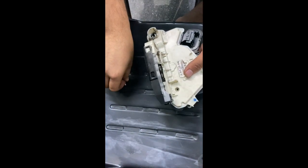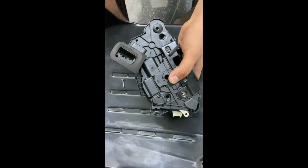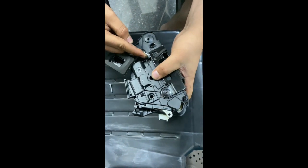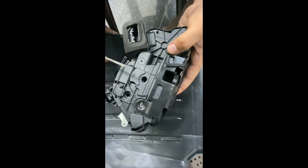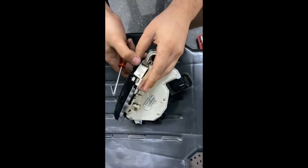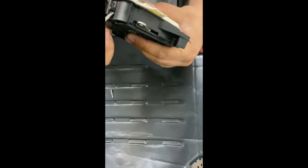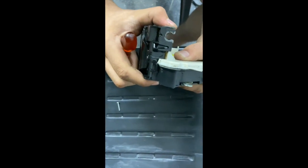This is what it looks like — it's a small pin that they smash at the end to create a seal. Your next step is to grab a flat screwdriver. You're going to lift up on this edge to get this clip out — it's going to open up a little bit like that. The same thing on the other side — just push this clip down. There's one more clip at the top, so just lift this and your lock will separate.